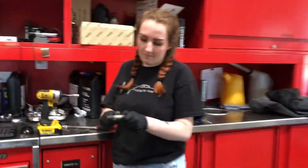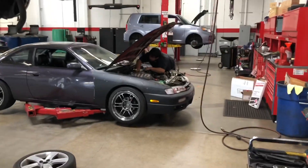The bottom bolt is 19 millimeter on each side — you just break it loose and pull the bolt out, really simple. Did both sides. I missed filming it since I'm more doing than filming, and she's trying to learn too so her hands are in there. Now we're going to move over and get the fronts done.